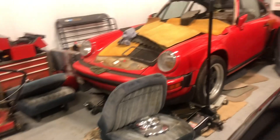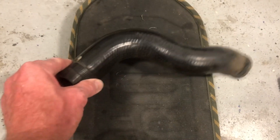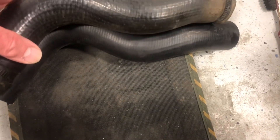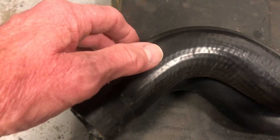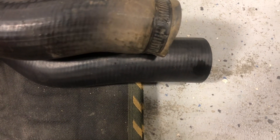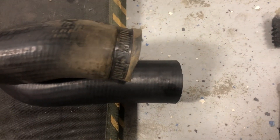I do have an issue which I'm not too pleased about, but that's the way it goes when you're buying aftermarket. This hose is my old radiator hose, made the 42nd week of 1981. And this is my replacement hose, which is a Euro hose. It's got a good bend, it lines up nicely, it bends nicely — but the new hose is too long. When I put it on there it was laying strange, kind of buckling and had a little crease in it. The bend is just not correct. Tomorrow I'm going to cut off some length of this new hose and see how it works.